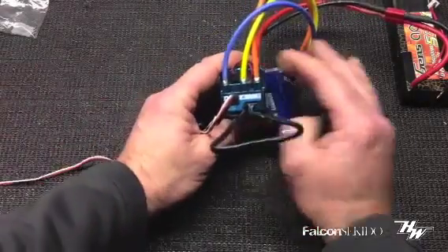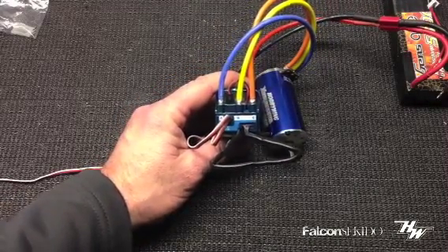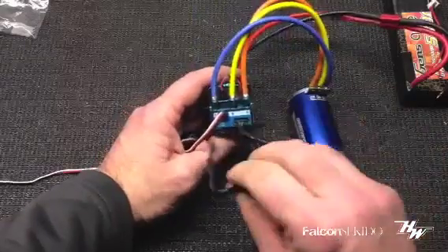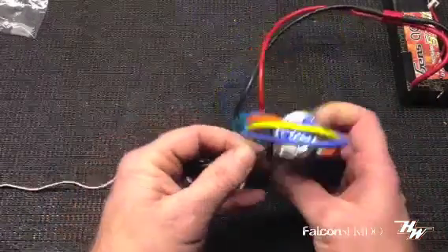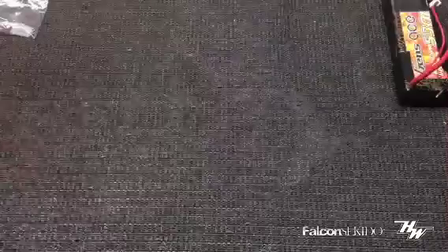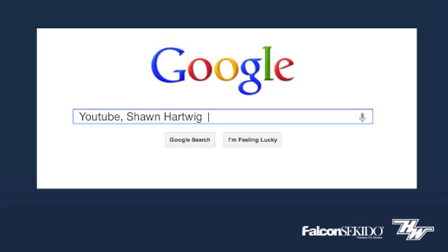Your motor wires are color-coded A, B, and C. The A wire is blue, the B wire is yellow, and the C wire is orange — and these match the motor's A, B, and C terminals. Your sensor wire is already attached and will plug into the sensor port once installed. Thank you very much for watching. The next video will show the system actually installed in my car. I'd also like to thank Team Hobbywing for signing me to the 2013 race season. Remember drivers — drive smarter, not harder.